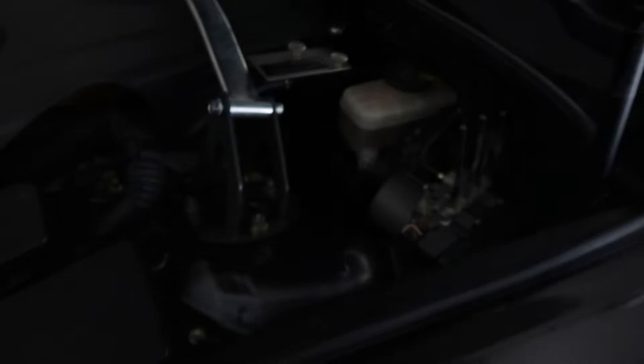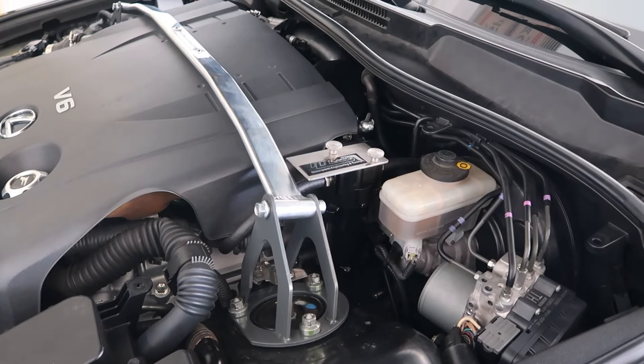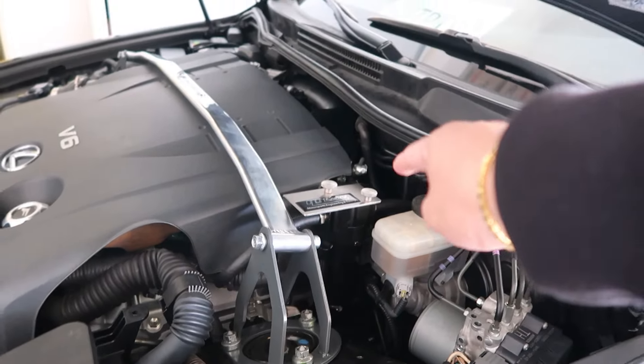The startup was hell of loud — that's the loudest I've ever heard it. I'm hearing a lot of hissing noise, and I think it's coming from the oil catch can. It seems like there's air escaping from the oil catch can. The car does not sound happy, and the hissing noise coming from the oil catch can does not sound good at all.